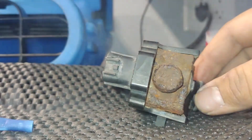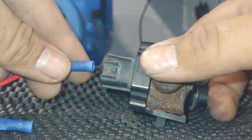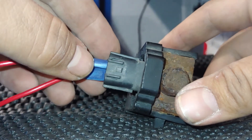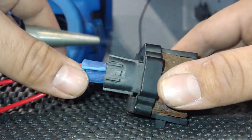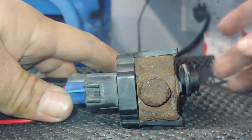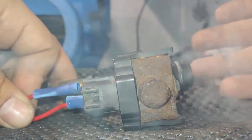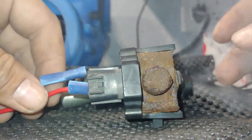So I've rigged up a little power supply. I've got my ground and I've got my power, and we should hear a click. That click is the solenoid closing and it should seal and not allow any smoke to go through — which in this case smoke is still coming through. I'm going to go ahead and remove the power so it will open, and now you see all the smoke just dumping through. So it is not sealing all the way as it should.